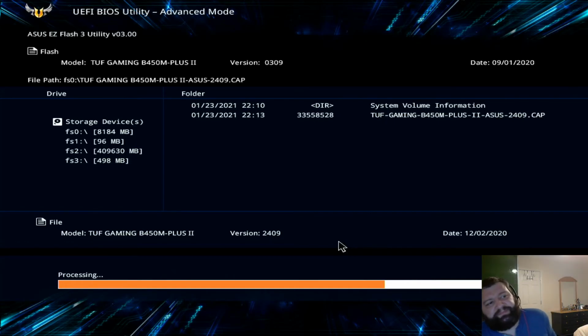This kind of problem doesn't happen often, but as you can see, it does happen. I'm kind of glad that it did, because it just illustrates how you get a new board and you have components that you know are working 100%. You've used them, they're from a computer that has worked without any problems. So these are known good components, and the only absolutely new, never used before component in this system is the motherboard and the case. Well, the case is not relevant, so the motherboard is what's causing this behavior.